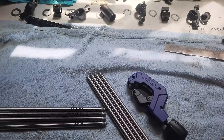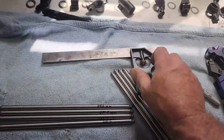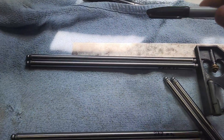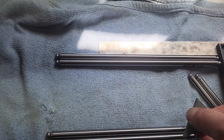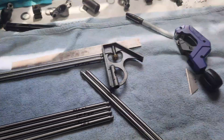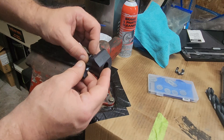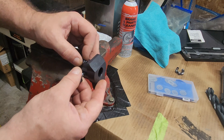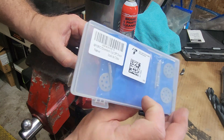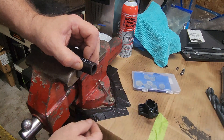I cut my pushrods — how I did it was a little bit of everybody's advice. I lined the pushrod up, put the other one next to it, put a black mark on it, figured out exactly what it needed to be, then cut a little razor line in it. At first I tried a Dremel with a special attachment — this would be screwed onto the Dremel and was adjustable. I tried these diamond cut-off discs from Amazon and they do not cut pushrods.